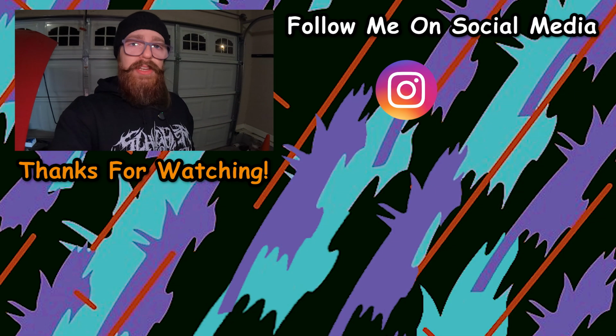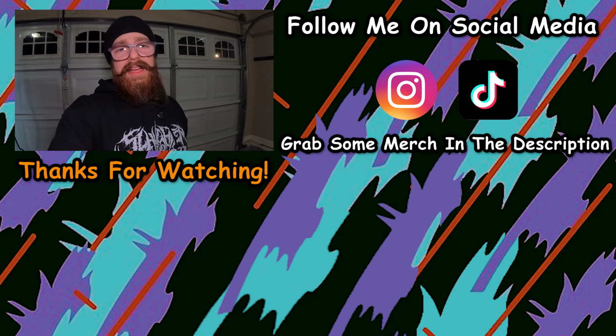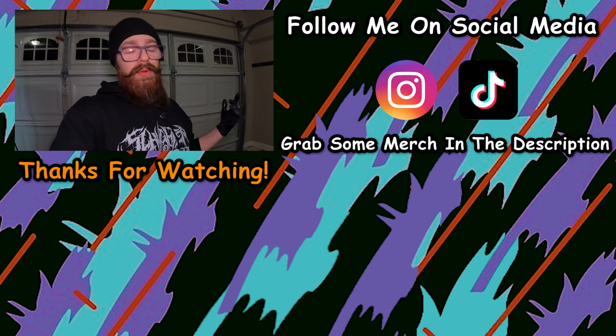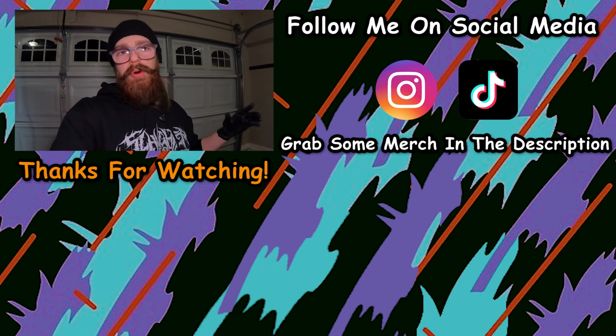So if you guys found this video helpful, sweet. Glad to help you guys out. And make sure your battery terminals are nice and clean. That will solve a lot of weird start issues, dim lights, or poor charging.